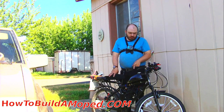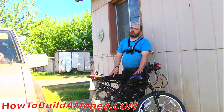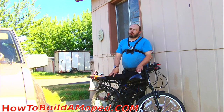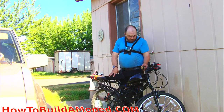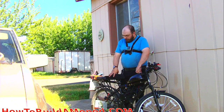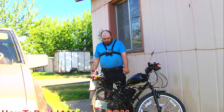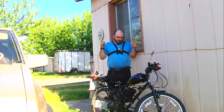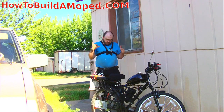The kit did not come with a 3.5-liter gas tank — it came with a 2.5, which is fine, but I preferred this one because it looks better and holds more fuel. I put the bigger jet on and we used more fuel, but I've still got plenty in here. If we can improve our torque or top speed with the next kit, maybe we can go to a smaller sprocket.